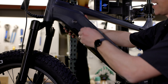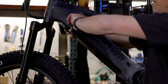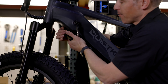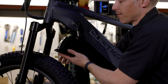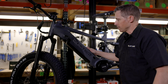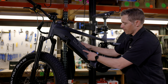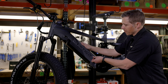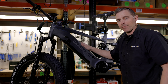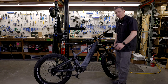A quick note — if you need to take the battery out of the bike, put the key into the lock core, turn it to the left, and pull on this battery release lever to drop the battery out so you can charge it by itself. If you want to charge the King Kong battery while it's in the Ibex bike, follow the down tube to the bottom of the battery area and you'll find a port there. You can access that charging port to charge the battery right inside the frame.